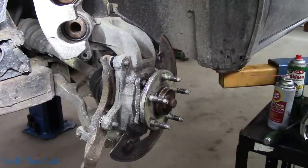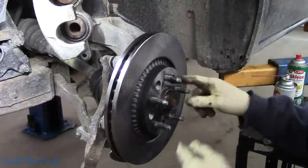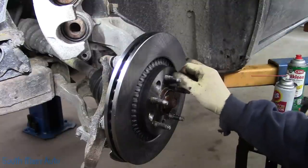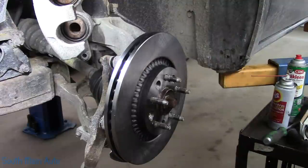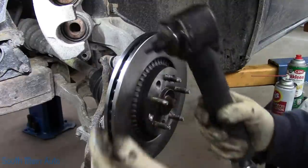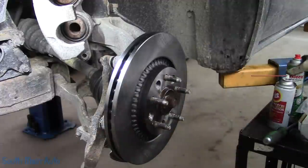We've got our rotor in here from Napa — not a sponsor of the show. Doesn't matter where you line this up because it's got screw holes all the way around. When you tighten these up, just use your mind and your muscle, very gingerly — torque setting one if you've got a torque wrench. It's back right there, and we'll brake clean this baby off.